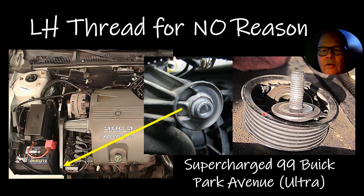It had a Torx head and it was a big old thing. I said, get this tensioner swapped out — it's real easy to get to right there. He went out there and said, man, this thing's really tight, I can't get it to move. He stripped the threads out because it was left-hand thread and he didn't know it. Nothing in any shop manual I've ever seen will tell you that the bolt holding that pulley on is left-hand thread. If the pulley spun the other way I could understand it, but it doesn't. Maybe somebody listening to this knows, but I don't know and I can't explain why that was left-hand thread.